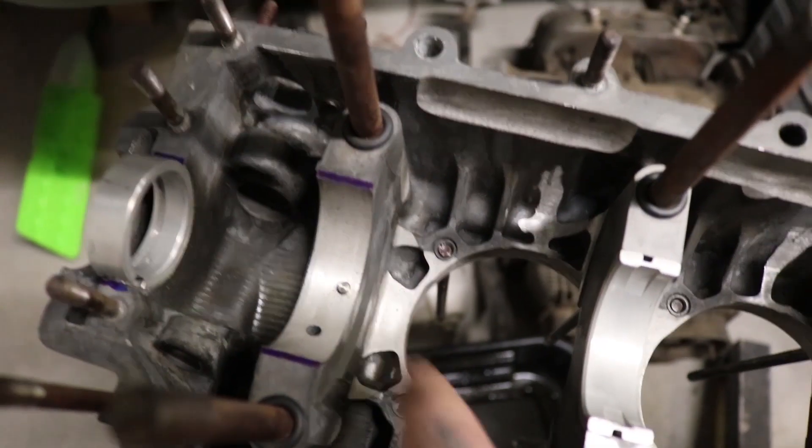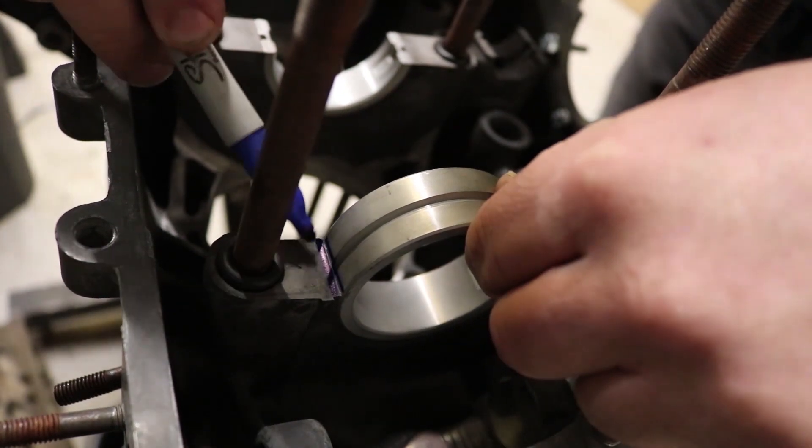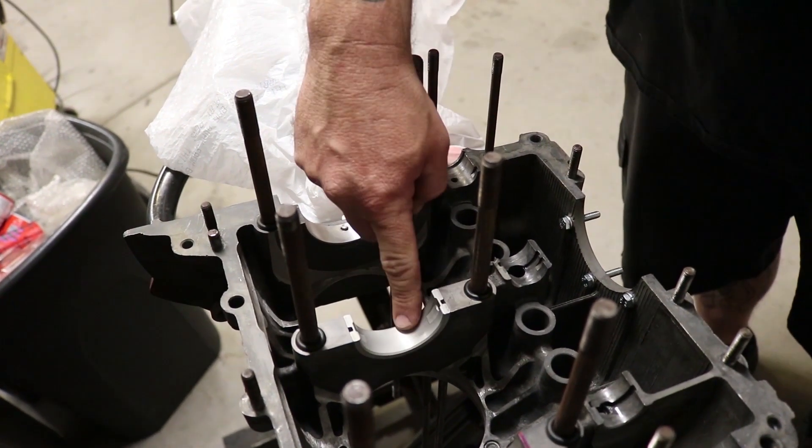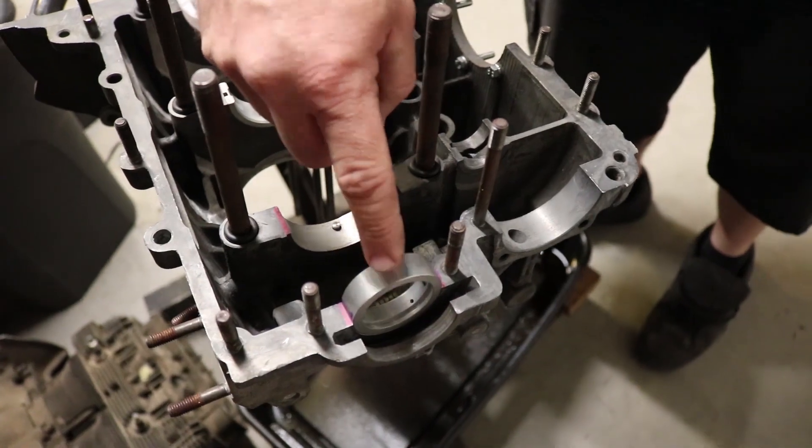Just making sure that I have the correct orientation on the bearing before I put it on there and put the gear on, because the pin is off center so it only goes on one way. If you put it on the opposite way you will spin a bearing because it won't be seated correctly. I mark it so that when I'm laying the crank in there I can position the bearing where it needs to be to drop onto the pin. First is your second, which is your center and that's a two-piece. Then your third is the third large one, and then the fourth is the snout — that's what they call the end of the crank — and that's the bearing furthest from the flywheel, and it's smaller.